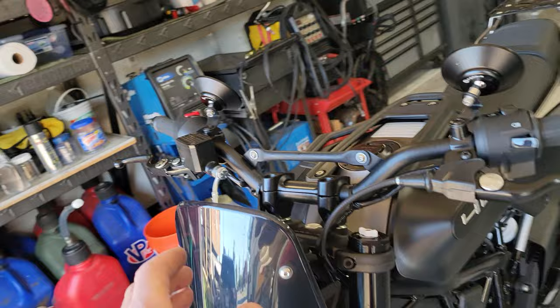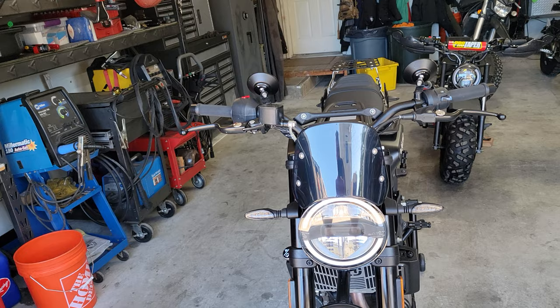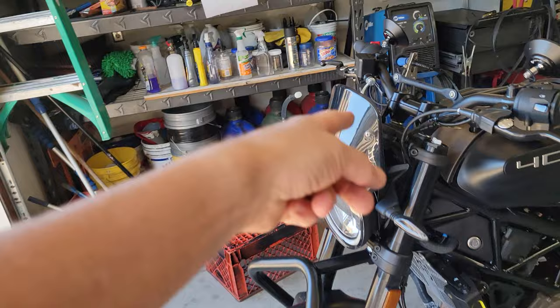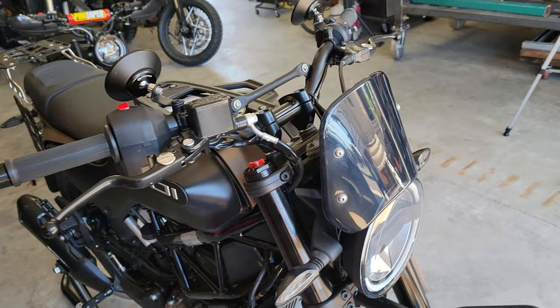This is not a full-on windshield, but it's supposed to create a fly screen — the air pressure won't be so great on your chest. It might be still on your helmet, but it's supposed to provide a little shield from bugs splattering against you and whatnot. I don't know if I could find anything better than $22 bucks. I will leave a link in the description for this. Once again, you are going to want to change that hardware out because it will rust immediately — anything zinc-coated standard steel is not good for a motorcycle. I use quarter-twenty stainless one-inch bolts.